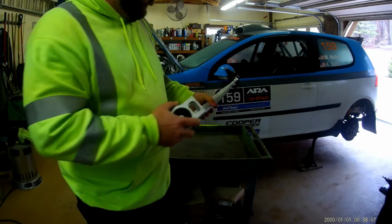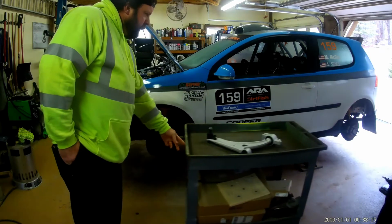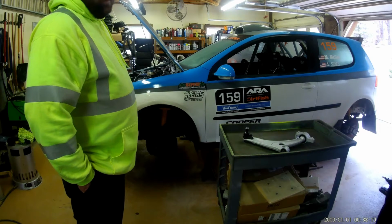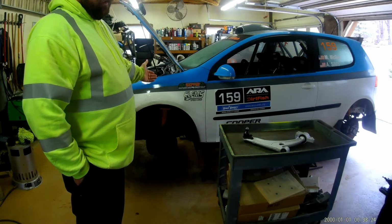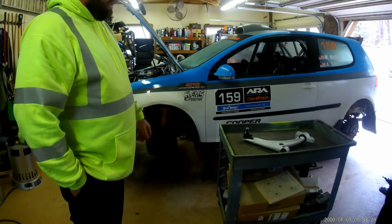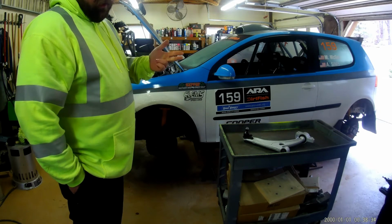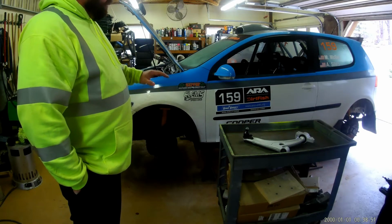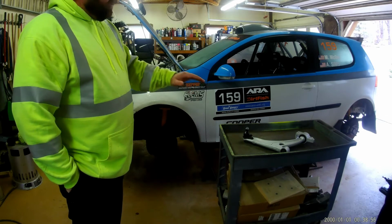We're getting ready to do suspension on this car. We will show you them when we get them. Right now we're running basically stock replacement stuff. They're Koni yellows, and GKR, Giant Killer Racing, made us some custom progressive gravel springs for those. That's what we've run so far at Southern Ohio, Show Me, and Snowdrift. They worked really well for Snowdrift because they're not super stiff. New ones will be, I'll show you when we change it, but we're changing all that on the car. So while we're doing that, I've been wanting to change the control arms to the aluminums. We're going to change that.